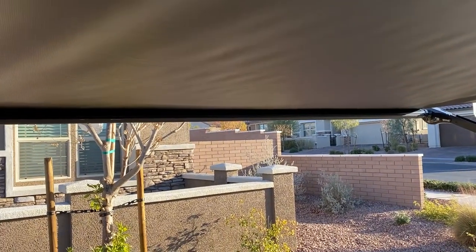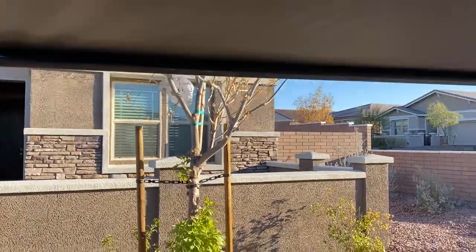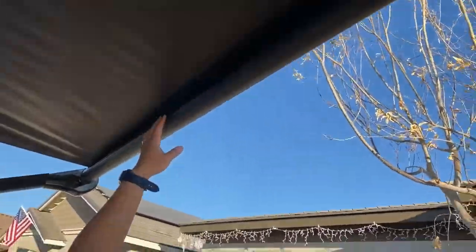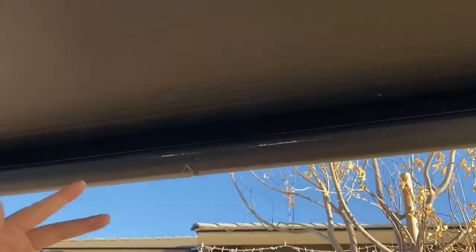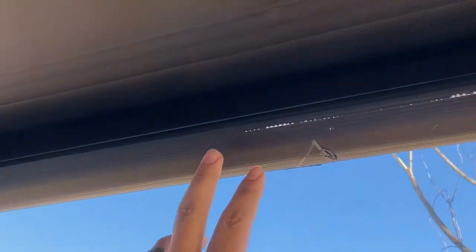So that's pretty much the end of it. Let's go out and take a look outside. You see this? This is kind of the end of it. So don't keep going after you see this seam right here. If you keep going, the motor doesn't know when to stop — you're going to reverse the engine and end up breaking it. So let's be very careful. Most RVs are designed like this, so I'm not sure why they don't have an automatic stop, but it is what it is.